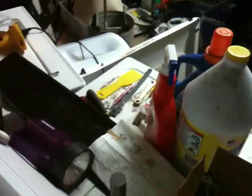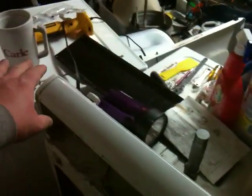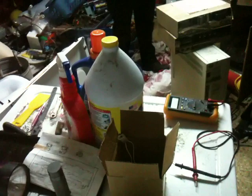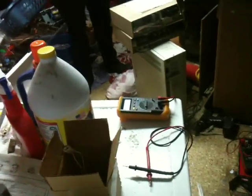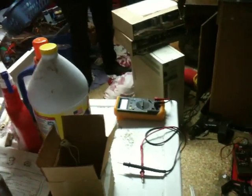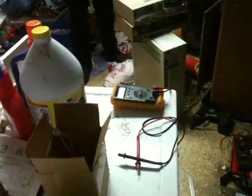Okay. So anyway, what you've got here basically, when this thing's sitting idle and nothing's going on, you press the start button and that does two things. That immediately introduces electrical power to the timer motor and to the electrical blower and drum rotation motor. And then from there, the timer takes over, and the timer has a couple of thermal sensors that it relays information to and from. But at the same time, an igniter starts up, and then the gas valves open, and a flame detector finds out whether or not the gas has actually been lit and turned into a flame. And if it isn't, it shuts the gas supply off and tries again a couple of moments later.